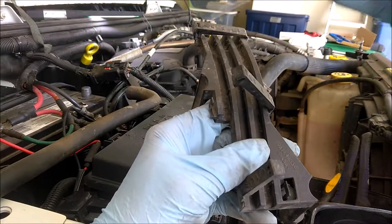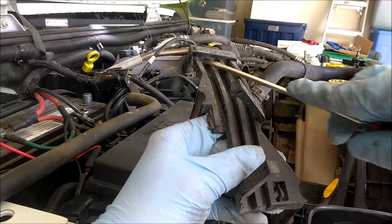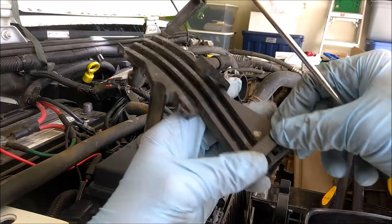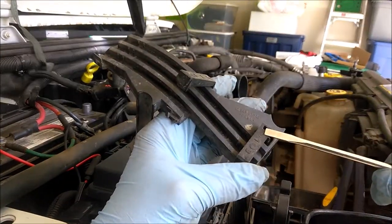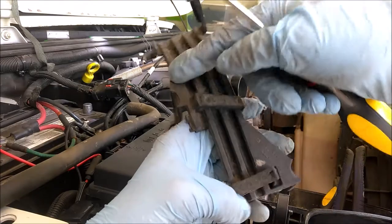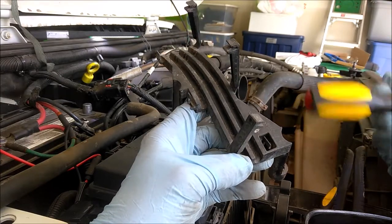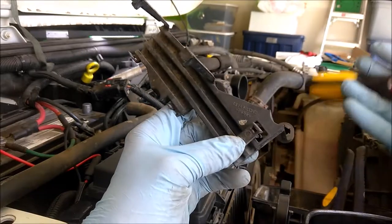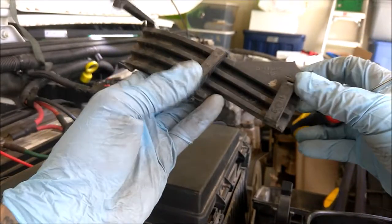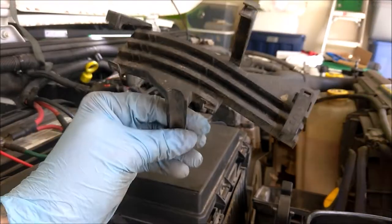Back here I just worked it and eventually got a bigger flat head, went under there, and popped it off - luckily it didn't break. Your plugs are marked as well - one and three are down here, and five is the third short one back. This thing would also be easier to get off with the wires unplugged. If you don't unplug them, you can still get it out, but maybe just fold them back down so they're not catching on everything when you're trying to pull it out, because that was a big problem.